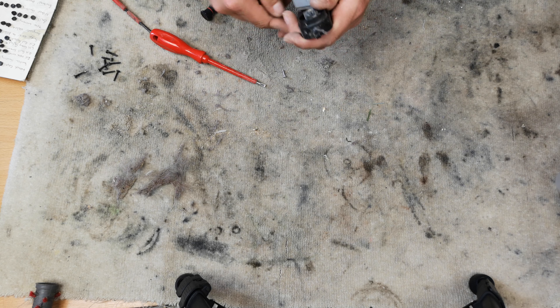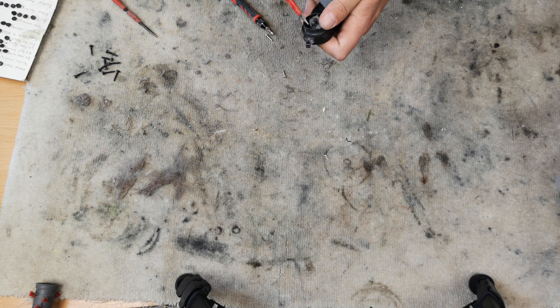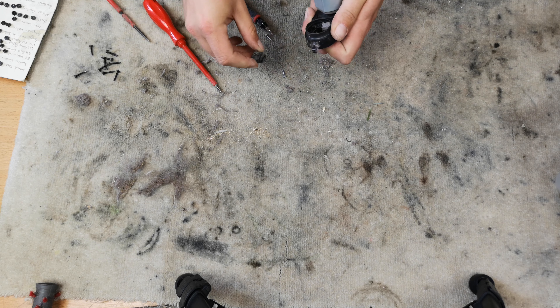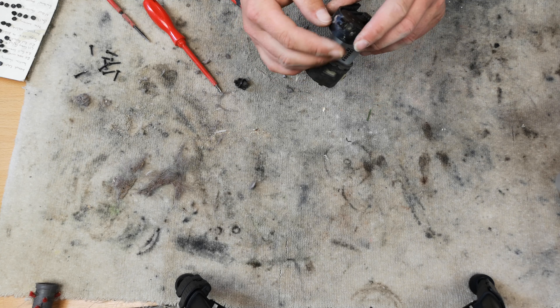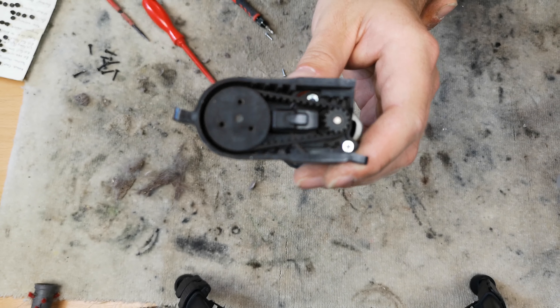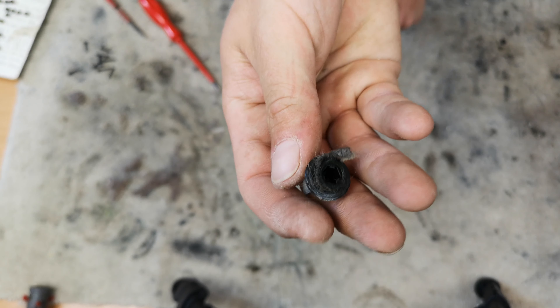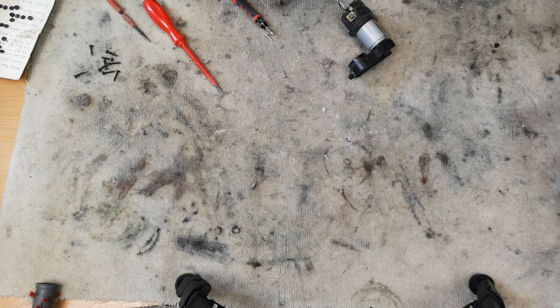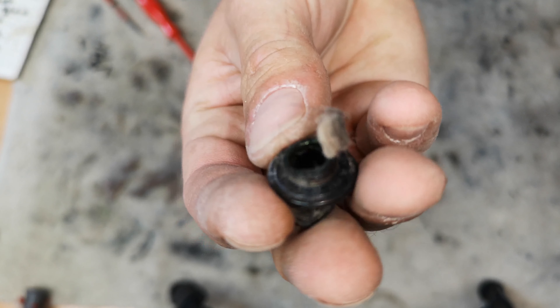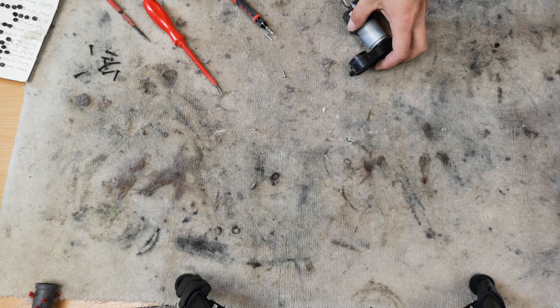I'll show you how to take the brush roll cog off - simply remove its screw, and then gingerly up it pops. Then you can get all of the fluff that sits underneath it out - very nice indeed. That belt never ever goes in my experience; I've never seen that go - it's always fine. The reason I say take the brush roll cog off is because if I turn the lights on on my camera, you will see it - all covered in fluff. So it's always good to get that off and give it a wash.